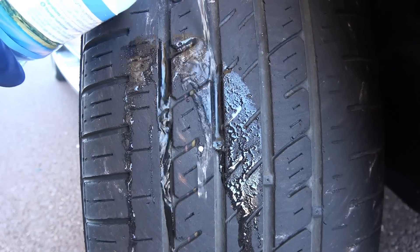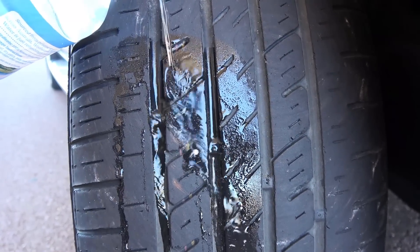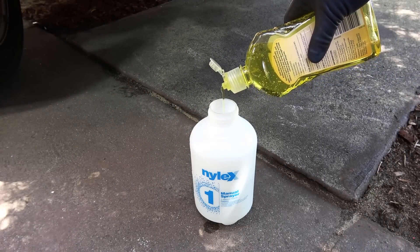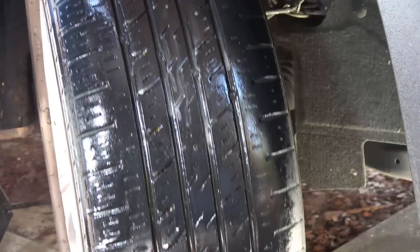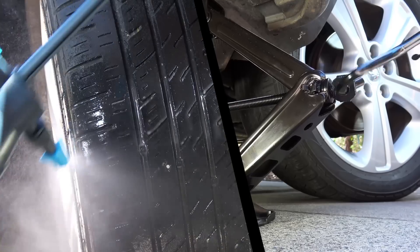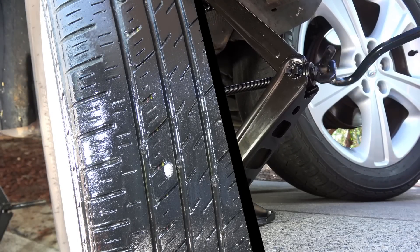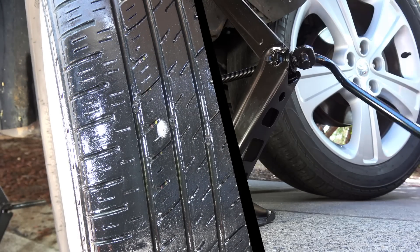In my case I was able to find where the leak is with some plain water. But if you have a very small leak, it could be difficult to find it with plain water. So you can add some liquid soap into the water, then spray down the tire, and when you get to the area where the leak is, you'll see the bubbles coming out like mad. If you want, you can even jack up the car just a little bit to spin the tire so you can get easy access to the leak — especially if your leak is in the rear tire, where you can't turn the wheel like you can in the front.